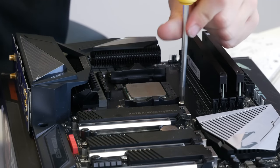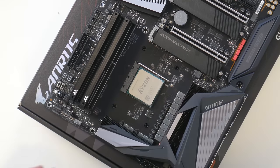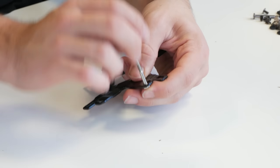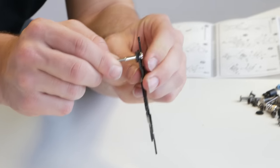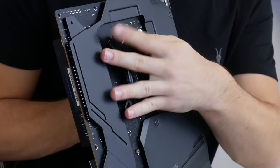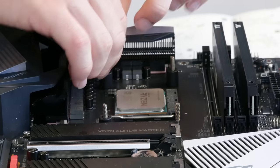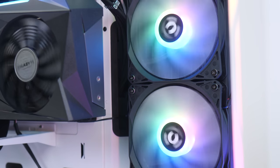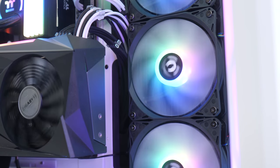This is where the CPU is going to get cooled, and it bolts onto the top of our RAM DIMMs with copper contacts on top of those DIMMs, which should really help with temperatures and aesthetics. First, we need to remove the pre-installed mounting hardware — both plastic brackets and the small metal backplate — and swap it out with the included backplate. We pop screws through it and slide plastic stoppers through to hold it temporarily, repeating for all four corners.